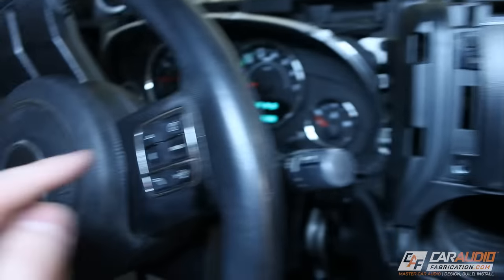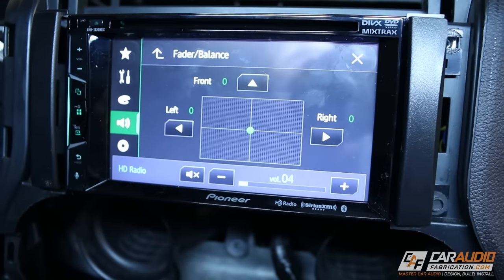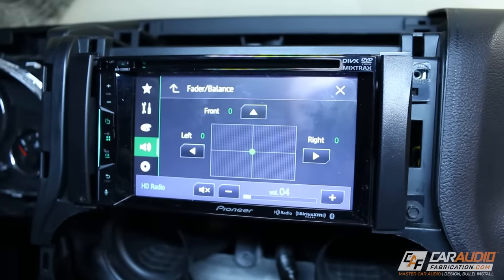The radio is in and I've reconnected the negative battery terminal. Now I'm testing the head unit to make sure everything is working. We confirm we have power, then use the fader controls to test the front right speaker, front left, rear left, rear right, and of course the subwoofer output. Now is also a good time to test all your steering wheel controls — make sure volume up and volume down work and everything else works as planned. Everything seems to be working perfectly, so now I need to reverse the process and reinstall all the panels carefully.